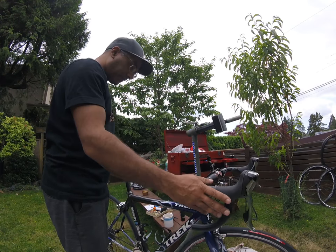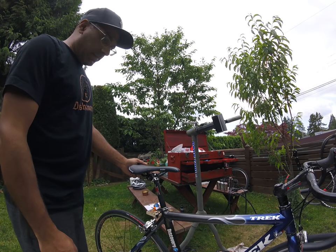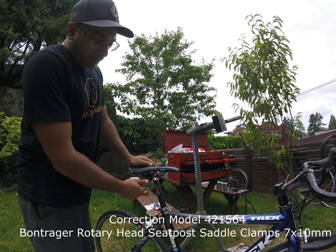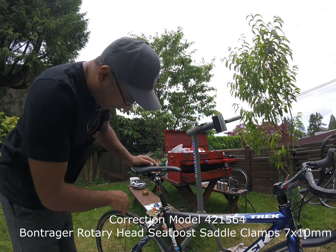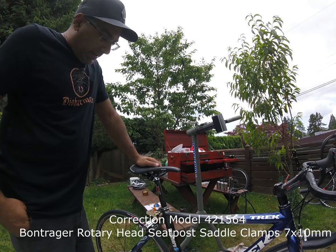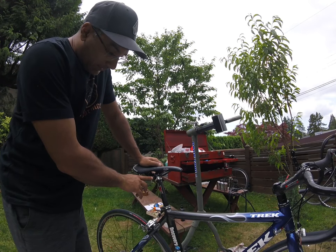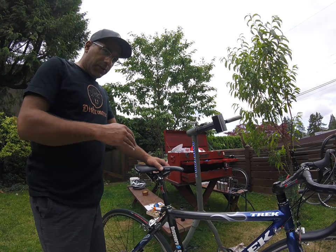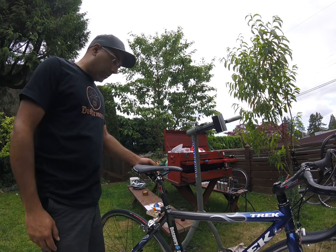Good enough. And I mentioned before, this is the best seat I've ever bought. I've tried a bunch of them. Bontrager Evoke RXL carbon rails. You need to get the adapter bracket for the, I think they're 19 mil rails, but that's 20 bucks at Trek, CAD, not a big deal, you need it. Scary thing is you actually have to crank this thing down to 16 newton meters, which is a lot. First few times I had it on, it would just go, and that's unsettling too, and it's almost as unsettling as torquing it that much. Anyway.